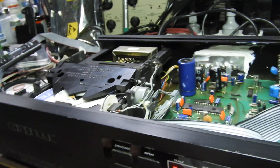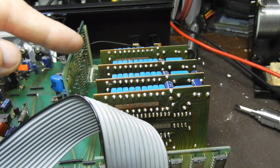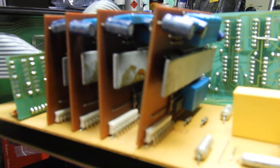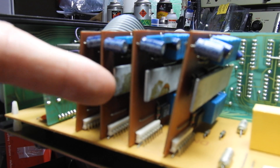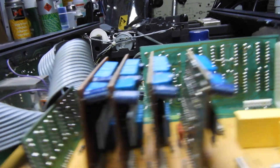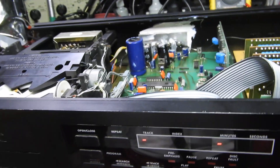Because other than that mechanism, it has not one, but four — four TDA1541A — the first Philips 16-bit chips. They appear to be original ones because those heatsinks are mounted on them and they're stuck very hard. So for real aficionados into those Philips chips, you could put four single or even double crowns there and have the most expensive CD player of that era, probably.